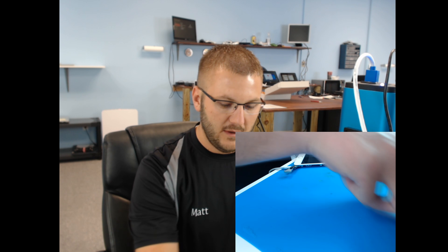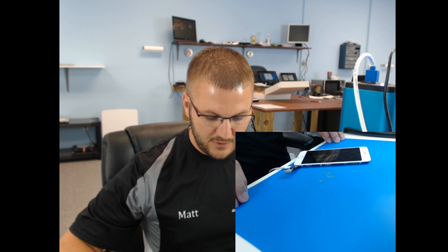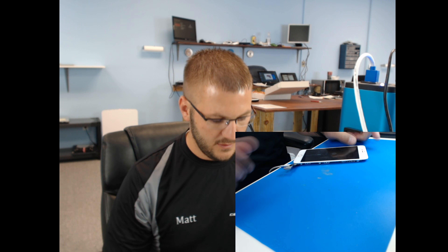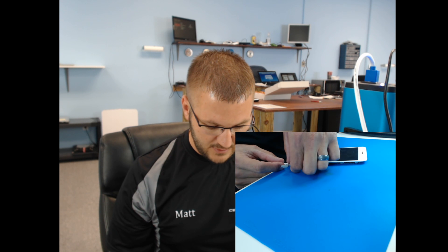It was stuck at an iTunes disabled screen. I called him and he said that's weird because he was just using it the day before he brought it to us. I told him it either needs to be plugged into a computer it's connected to iTunes before, or it's going to have to be restored. He said restore it — all his stuff was already backed up. So I plugged it in, iTunes started the restore, and it errored out at error negative one, which doing some research shows is a baseband problem. At this point we're stuck on the iTunes logo and we're going to get the error negative one.